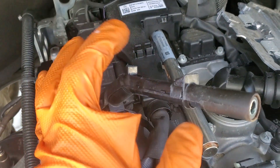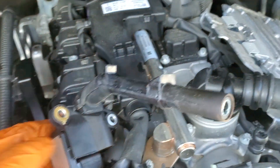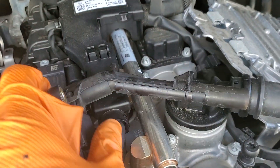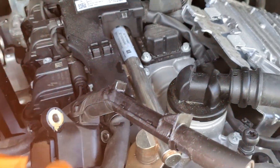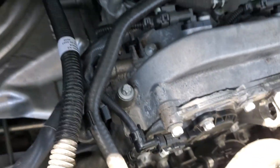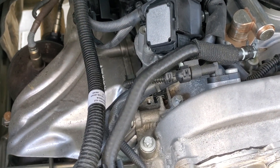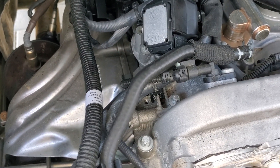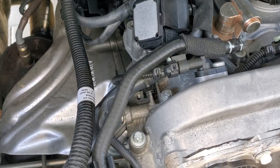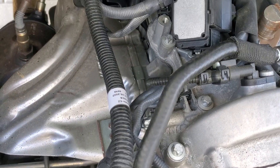Just be gentle not to torque it. These coil ends are almost like handles — little lips. Get your fingers on these like handles and just take it out and wipe it with a rag; it had a little grit on it. The other thing I'm doing — which some people do and some don't — is blowing out the hole before I pull the plug with some compressed air. Cautionary tip: some debris shot out of there like a BB gun, so have your protective eyewear on and shield your face — it peppered my face pretty good.